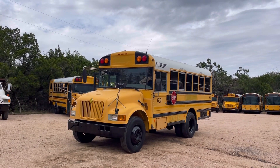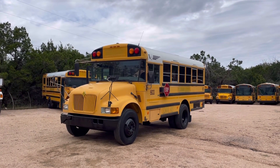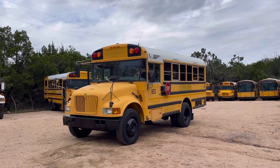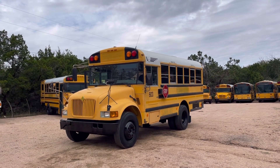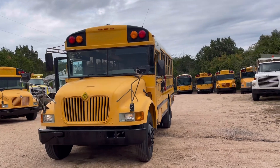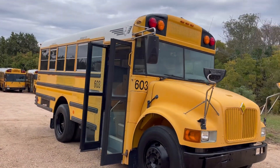That's how I check out a bus. I always tell people I need five minutes with it and I'll be able to tell you if I want it or not. But if it was a first time, I'd definitely spend a little more time — let it run for 15 to 20 minutes to make sure it isn't overheating. If you've checked out enough vehicles over the years, you'd probably catch it sooner. You'd smell things like antifreeze or just the smell of an engine that's been overheating or having issues.